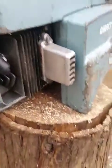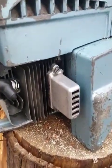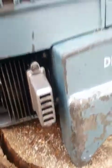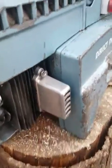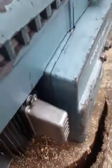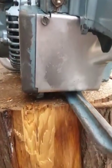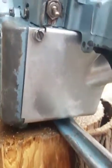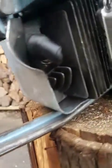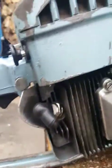It needed a replacement silencer. There are a couple of options for them, but this was, as far as I could tell, one of the original silencers on the early model. This one came from America, from a dealer. It was good value — only £14 delivered. On so many of these Homelite C51s, if you ever see them for sale, they'll be missing this top cover on the engine, which is really important because it directs the air from the flywheel across the fins of the engine and keeps it cool.